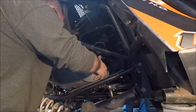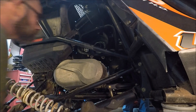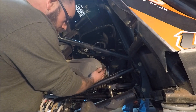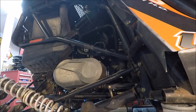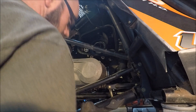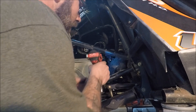Slide this in. I did remember earlier we marked our long bolts with a sharpie, so I do have my marks on here for where my long ones go. I'm going to get a couple of these started, making sure to line everything up. This piece will have to get back up in there — the bracket for the air filter. These do get torqued down to 8 foot-pounds.